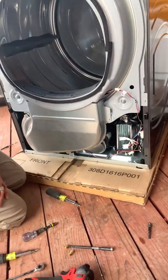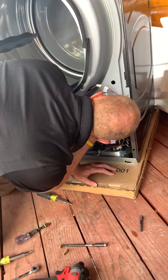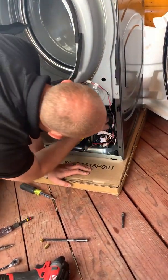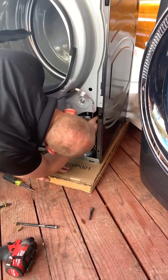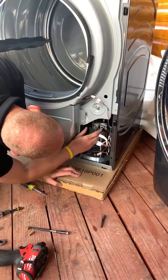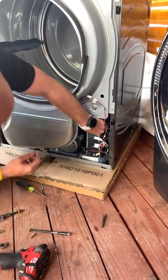That's good. Let me just look in there and verify that they're connected. Beautiful. Then thread the gas line through its spot. At the same time, line that up with the orifice for the venturi. Then it drops down and we're ready to put the screws back in.